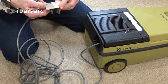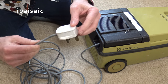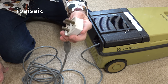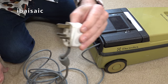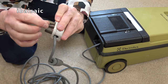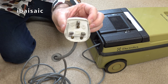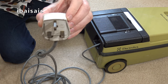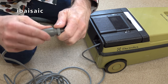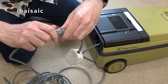And the plug — is that an Electra? It's an Electra plug, which means the plug would have been bought from the electricity board, one of the showrooms. Now that plug itself — the pins are a little bit distorted. I'm going to put a new plug on before I turn this on, because the pins are quite distorted. I don't want to risk doing anything. This part here can be moved — that basically just stops the plug from bashing into the cleaner when you rewind the flex.